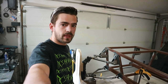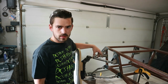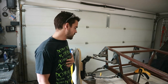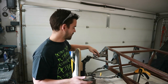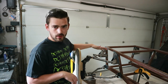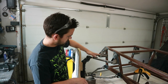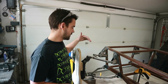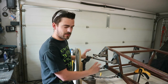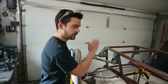That's about perfect for the lower control arm. Now we're going to do the uppers. Since the top sleeve is just tacked in, we should be able to grind the tacks off and rotate the sleeve. We have to tilt these in the opposite direction — they actually have to tilt this way. I might throw a brace on here, just temporary tack it on so it keeps that spacing correct, and then we can do what we need to do.